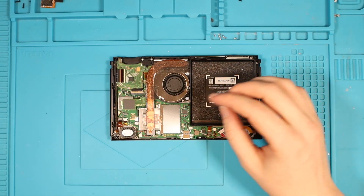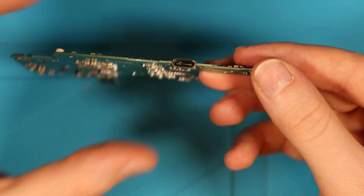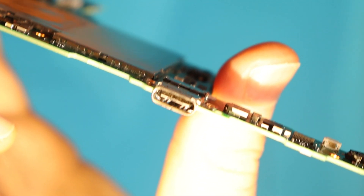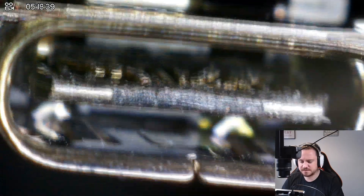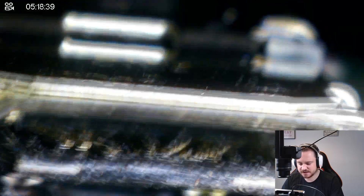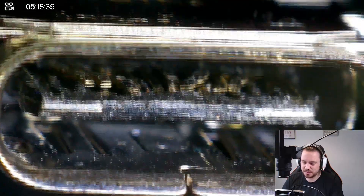We've got the board out. I'm going to get the thermal paste off the board. Looking at the charging port under a closer inspection — I can see a couple of the gold contacts look a bit spread out. Shining a light in the port, I've got the microscope in a better position so you can see the state of the inside of the port — there's a lot of stuff that shouldn't be touching where it is. We're going to replace the charging port; attempting to put those contacts back would be more effort than replacing the port.